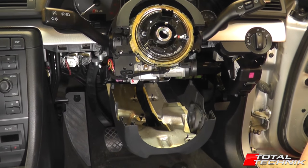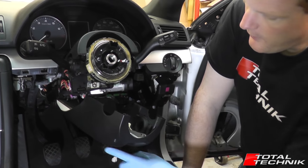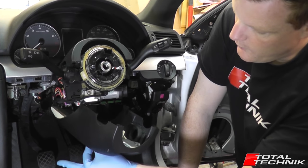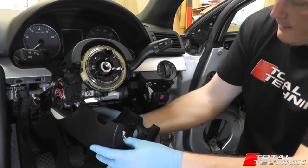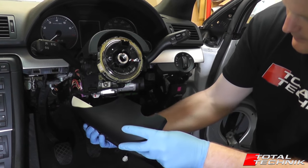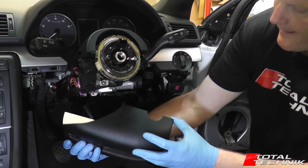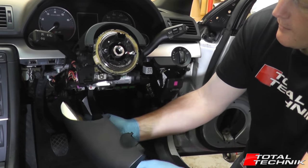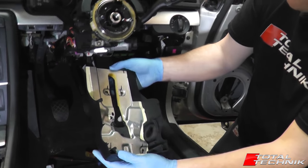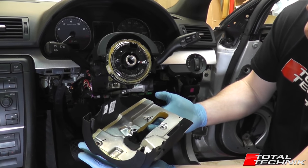There's a little trick to getting this off. So as you can see, it's completely free. The only thing stopping it coming off the car is the lever for your steering wheel column adjustment. The trick to getting this off is to try and twist it at a slight angle — it's a little bit awkward, and this is why we have to remove the lower panel to get access to it. But as you can see, you kind of put it over, twist it, take it back and you can get it off. That's the key to it — giving it that little bit of a twist. And that is your lower steering wheel cowl completely removed from the car.